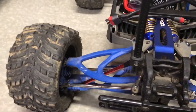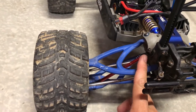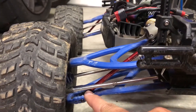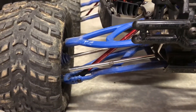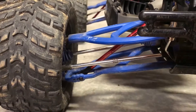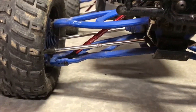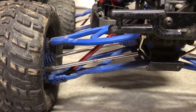The arms themselves are pretty solid. An issue we were having before is that the push rods were popping out of the rocker side or on the suspension arm side, right where the rod end is. The push rods themselves weren't bending, but the rod end was pulling out, and when that happens you lose your suspension and then you have to stop bashing. You either force the push rod back into the rod end, which further stretches it out and causes it to slip more, or you have to stop, unbolt it, screw a new one on, put it back together — and while not a very big deal, it does cause a delay when you just want to be out there driving.